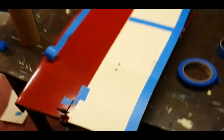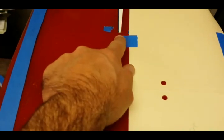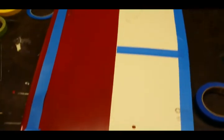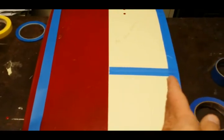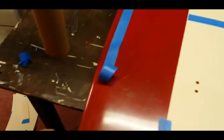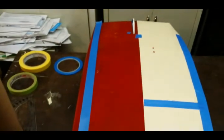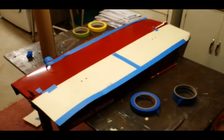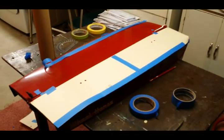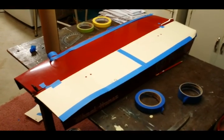I've taken my manila folders and measured off a half inch from the center of the slot as well as a half inch off the center of the hood ornament — that's where one outer line of the panel will be. I'm keeping this line as straight as possible so I know where my edge starts. The panel is going to come off to this direction, keeping a strip of original paint down the center, with the panel curving across and back, so original paint is all the way around it. I'll border it with black paint.